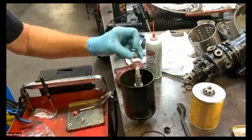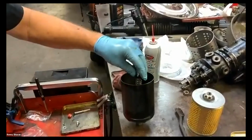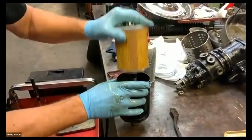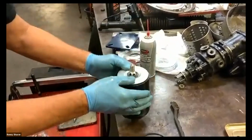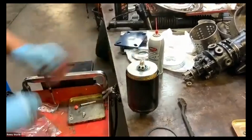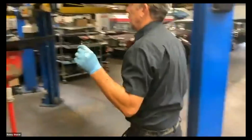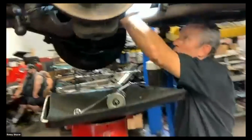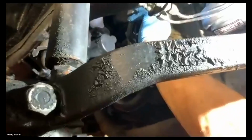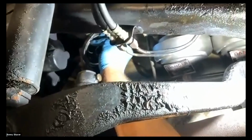then that sleeve with the wide end up, and then this rubber thing. And what happens is, as this compresses, this rubber part fits into that little cone and keeps the oil and directs it through the filter rather than around it. So this is ready to put on. You see it's spring loaded. So then you have to put the seal on the car before you try to put that can in. And here we go. You kind of stretch it around with your fingers. Of course, it's on camera, so it'll be difficult.